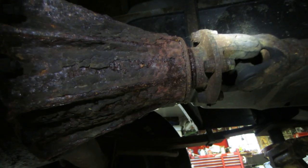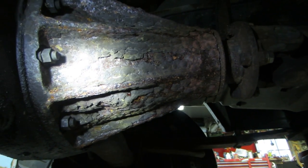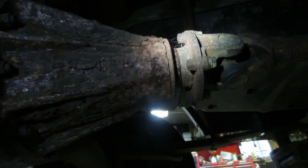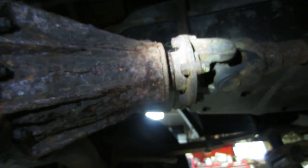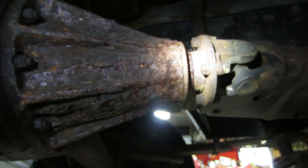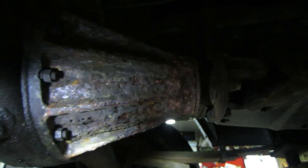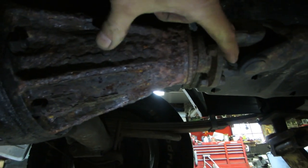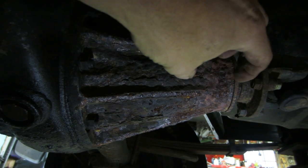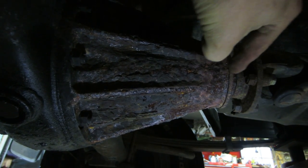The carrier on this one — you can see the color distortion, more orangey towards the front. He said the truck was running and driving erratically, then all of a sudden it got really loud, started to squeal, vibrate, shake and shimmy. He pulled over instantly and had it towed. When he looked under the truck right here was glowing red. So that bearing is absolutely baked. I don't know if it took out the carrier housing or the pinion.